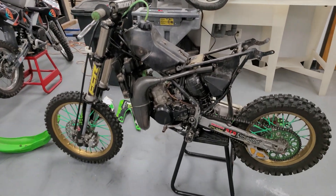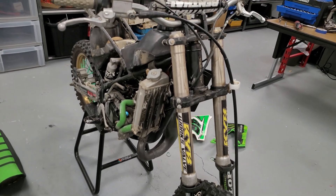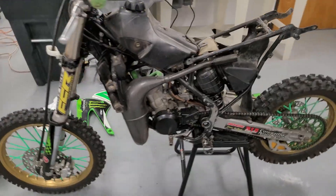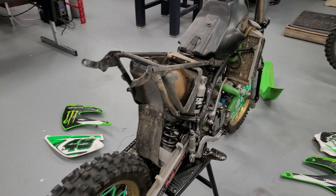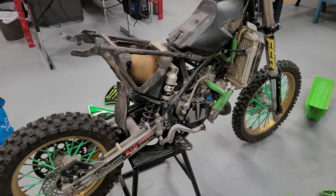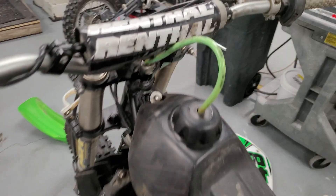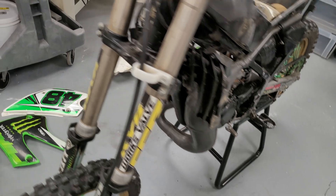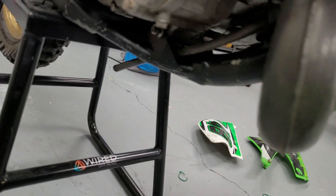We got this thing stripped down pretty quick. Some of the issues you run into on these is they've got a whole mismatch of different bolts — people break stuff, people lose them, and then they don't replace them with the original sizes. So you got some 10 millimeter heads, some 8 millimeter heads, some 11 millimeter heads. Once we put it all back together we'll make them all 10 millimeters. Next step is going to be draining the radiator, disconnecting the gas, and removing the gas tank. The gas tank comes out and then you disconnect the hose on the bottom, shut the petcock off. The radiator is pretty easy to drain. I'll probably take off the muffler at the same time — the muffler is just barely held on right now. There's a drain plug right down there. I'm going to go get myself a nice little bucket.